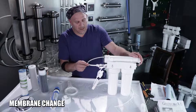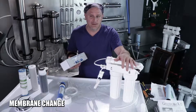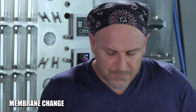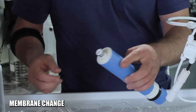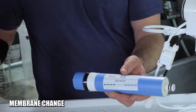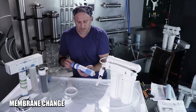You're welcome to clean out the membrane housing with dish soap and a brush if it's really dirty — make sure you get all the soap out. We're going to take a new membrane; this is a GXM 200 HF, 200 gallons a day. If this is a 100-gallon unit like an EX100 and you want to up the flow rate, you can put in a GXM 200 and it will double the flow rate. I'm going to lubricate the o-rings that go inside the housing and also the brine seal. Like all our membranes, there's a direction of flow indicated by an arrow on the sticker, and the brine seal is always the last to go into the housing — put the arrowhead in first.